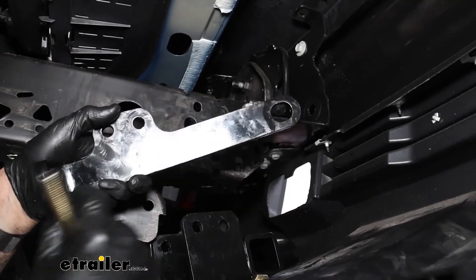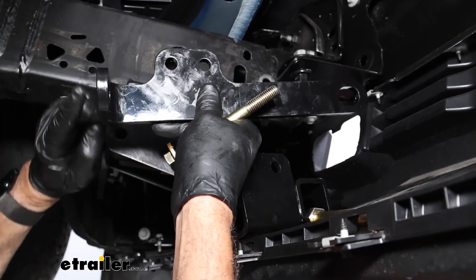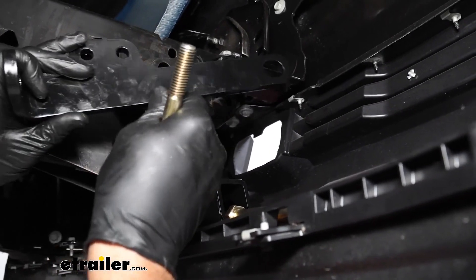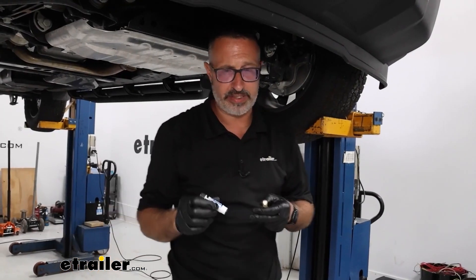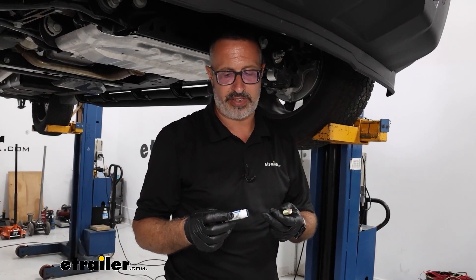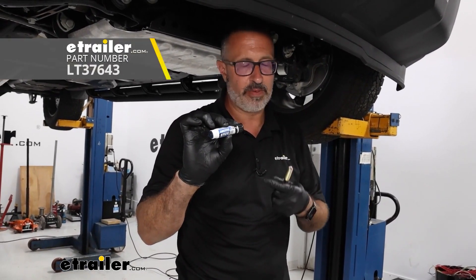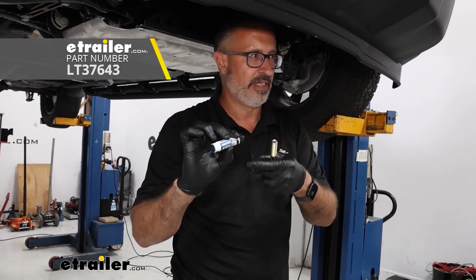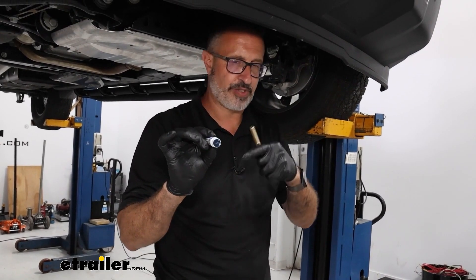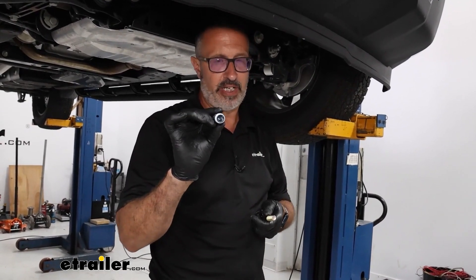The safety chain plate is going to have a curve on it. This curve goes towards the inside of the truck. So on this side it goes this way; the other side is going to flip over so your tabs will be up on top. This is the driver's side one — these are side-specific so make sure you have the right one. Just a quick side note: the instructions don't call for any type of thread sealant and in this instance we have locking fasteners, but for a little extra security I do recommend using blue Loctite. We have it here at etrailer but you can pick it up at big box stores or auto parts stores as well. They have two different colors — blue and red. Red is more permanent and may require heat to remove, so blue is going to be the best bet for this.